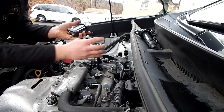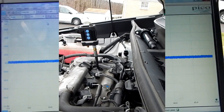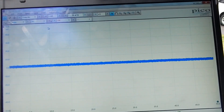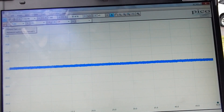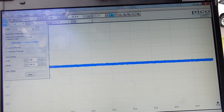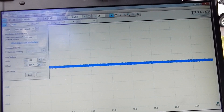You just install the WPS right into the hose that it comes with. The nice thing about using PicoScope with the transducer is it has a built-in probe. I'm just using the WPS500X in range one to do in-cylinder testing.